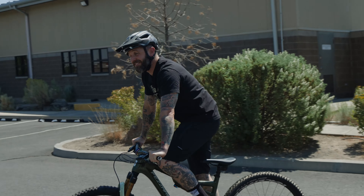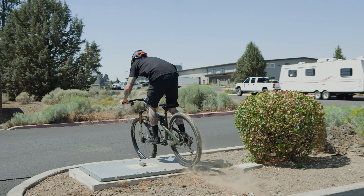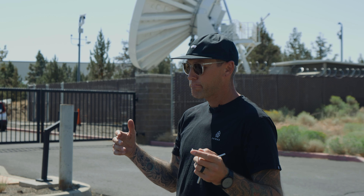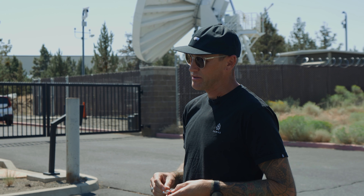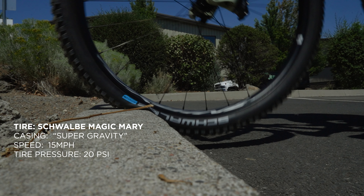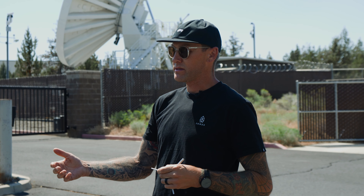Wow, that was crazy different! I just went at 15 and a half miles an hour pushing into the curb — didn't hit rim. With the Super Gravity you can see how that stiffer sidewall, with the four carcass layers plus the larger apex, really gives you that progressive feel. Hitting the curb, you can take more speed and a more aggressive line without risking damage. Initially a little more shock to my arms, but once I recalibrated, it just felt like the tire wasn't even bothered going over the curb.